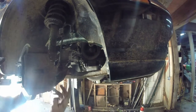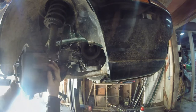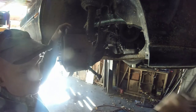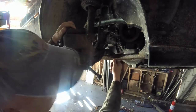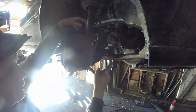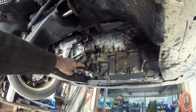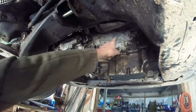In order to remove the transfer case — seeing how I had the subframe bolts loosened down for a little more room — you have to pull the ball joint down. There's a plastic cover you pull off, and there's a half shaft that goes from the wheel all the way through. You pull the ball joint down, undo the nut, pull it back, and then tap it out with a couple of crowbars and a hammer. It came out all right. Then you unbolt the transfer case — there are four bolts. I had some galling on one of them but it wasn't too bad.